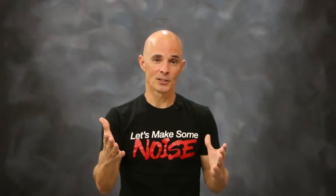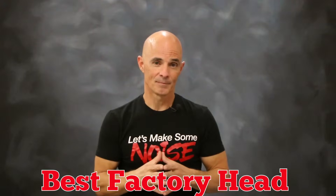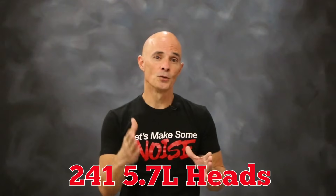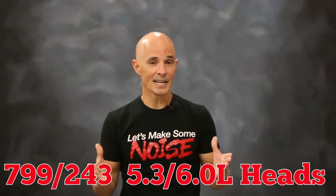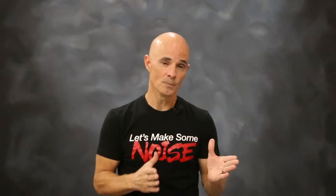Now there's a ton of good aftermarket stuff out there, but for guys on a budget, they want to find out what the best factory head is. To find out, we set up a test. We included four different factory heads, starting with the 706-53 truck head. We compared that to the 241 LS1 head, the 317 6-liter truck head, and the 799 head, which is basically the equivalent of a 243 used on the LS2 and LS6.